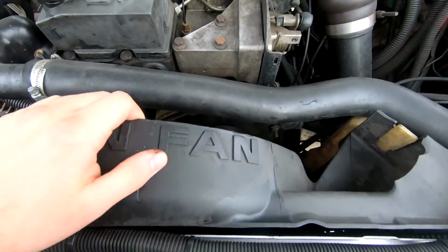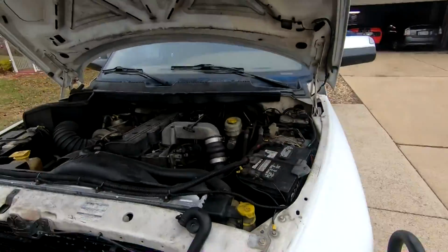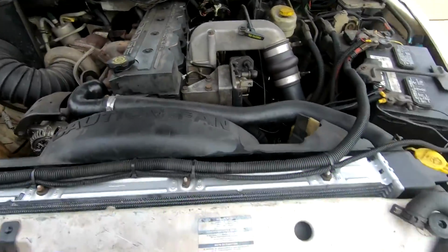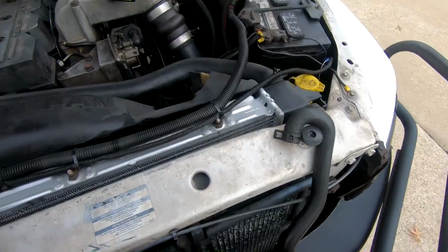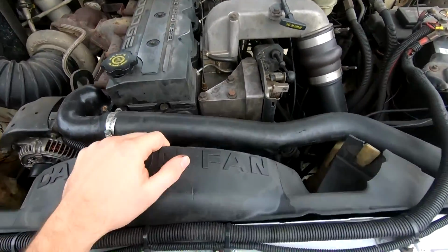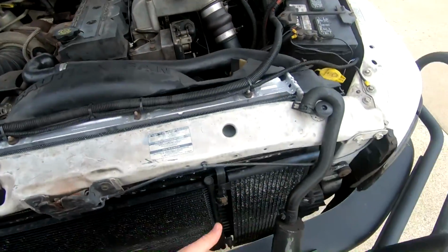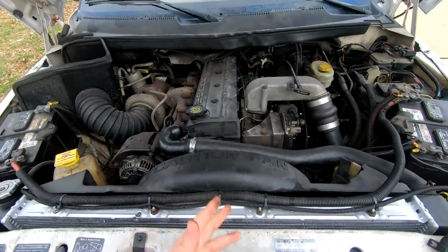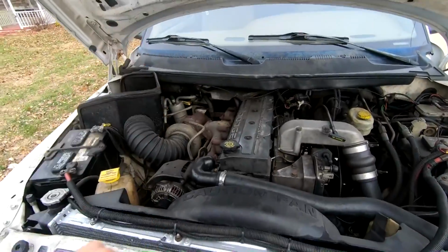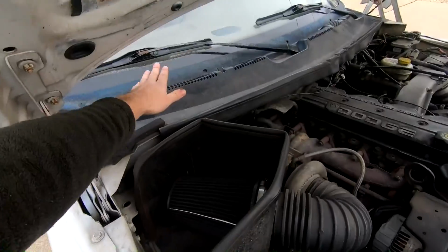I already have the hose. I'm going to reuse the same stuff I was using for my heat exchanger hose, and it's about the same diameter, 3/4 inch I believe, and get some elbows and hose clamps. That should make life easier, because I think it looks dumb up here. You also get some residual oil vapor smells in the engine bay and cabin because your intake's right there. So I don't like that. Not the air intake, your cabin intake.